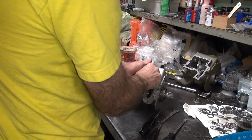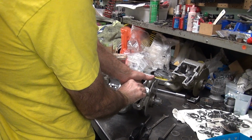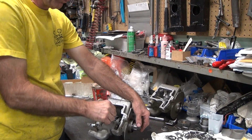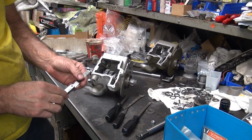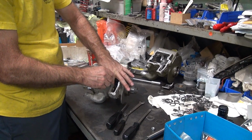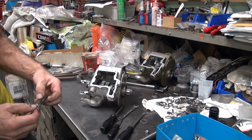Does it look flush to the gear? Try going down the blind side over here, but I don't think I can get in that direction. No. Can't get in there from that direction. There, it's tight. See, I'm jamming it in there. 23 is tight further down in there in the middle. Drop back to a 20. See if 20 ever gets tight anywhere. Yeah, pushing it in. 20 gets tight way up under there.